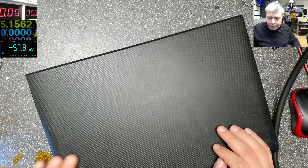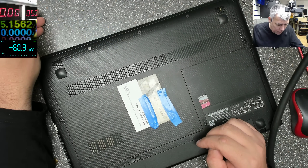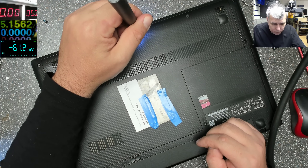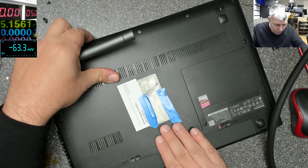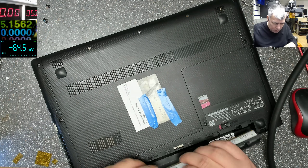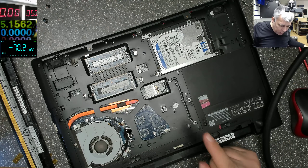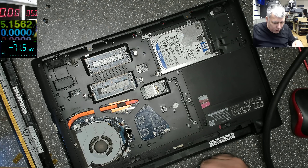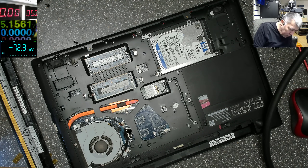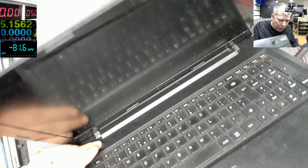Let's try to fix this quickly. We can do some checkings here on the back. The laptop has a seal here — you can see there's a screw behind this, so it was never been opened before. Plug in the charger, we still have no LED. I just took out the battery, as I thought, and probably now it's coming on — but it's not.